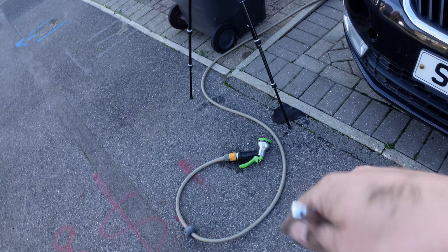Guys, the inside of the bonnet, at least, is done now. It's got a set, it's got a dry off, it's got a flash off, whatever the paint and lacquer need to do, but it is done. Now I have quickly removed the masking from right on the edge, mainly because I don't want there to be a hard edge. I want it to settle quite nicely, especially when I flip it over and paint the other side. I'm going to be painting right the way under, so that there isn't a hard edge that you can see from the outside.